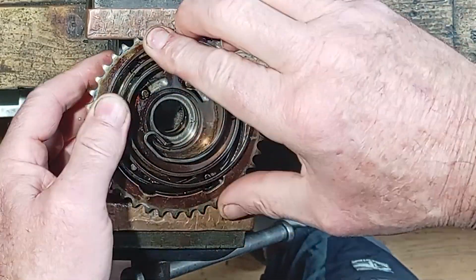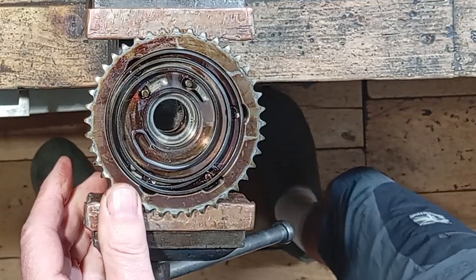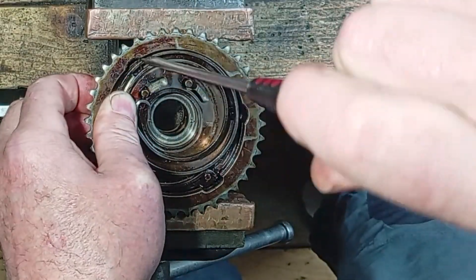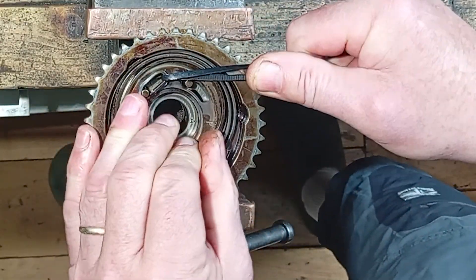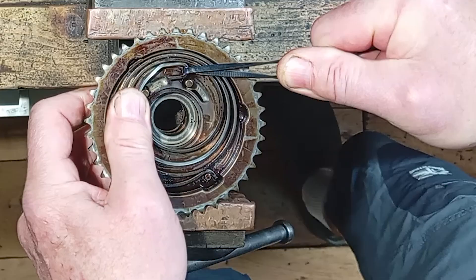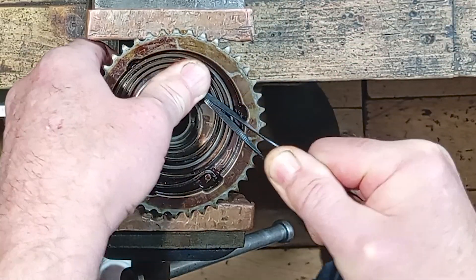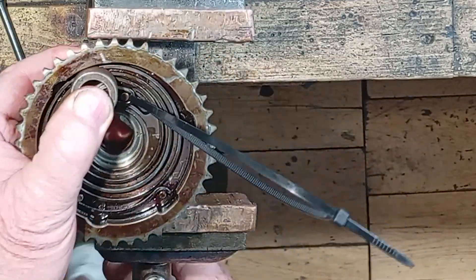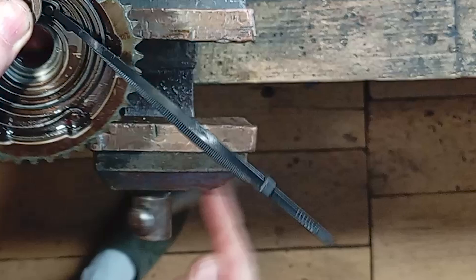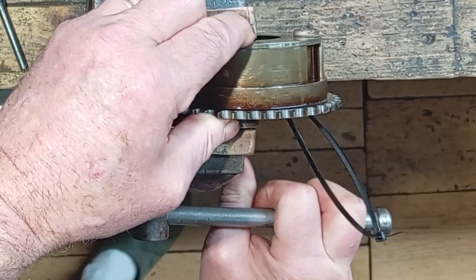Refitting the main spring is tricky — I used a thin cable tie as shown. Note where the spring fits about the protruding pins; it's a little difficult to lever them into place. Obviously caution is required as you tension the spring to make sure it doesn't jump off or up at you. I found it easier once I had fitted the spring to secure the phaser in the vise with a spacer, then cut the cable tie to pull it free.